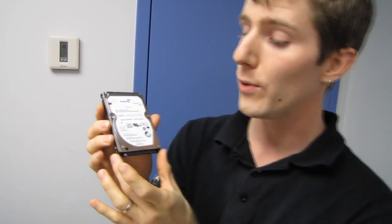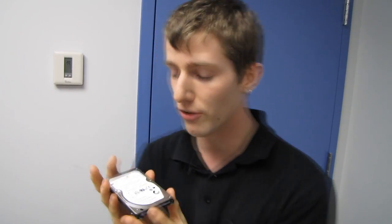Including a really cool thing called Fast Factor Boot, which the very first time you use the Momentus XT second-generation product to boot up your notebook, it will cache all of your boot files into the 8GB SSD. Then it will leave them there. If you have a different OS it'll eventually overwrite them, but the point is that if you have it booted up for a long time and use a bunch of different programs over and over again, it will not flush those boot files out of the SSD.